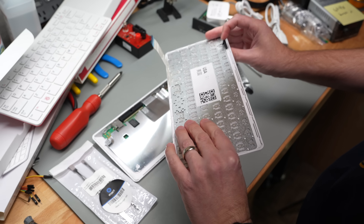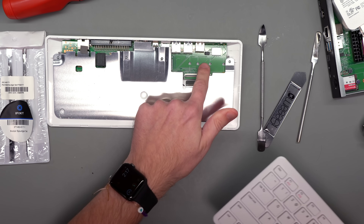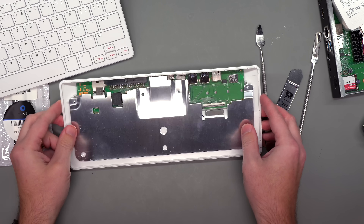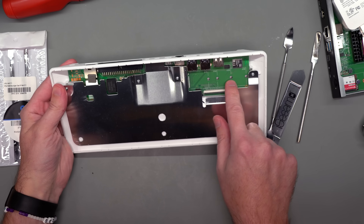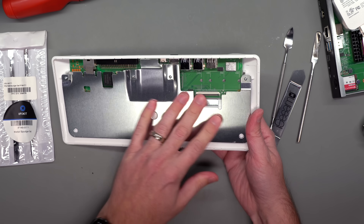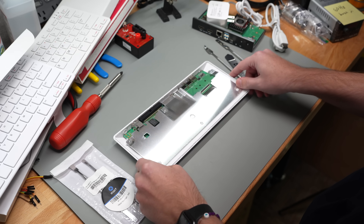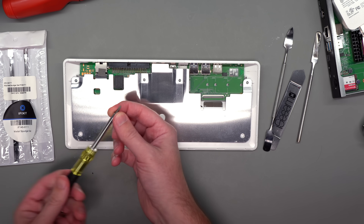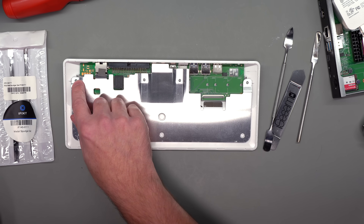There's a light pipe for the three LEDs that goes down to the little motherboard peeking out back here. The inside is dominated by the heat sink, just like the Pi 400. These screws are not really made to be user serviceable — if you use just a small number-zero screwdriver, it has a little play and it'll strip these screw heads. You might want to use a bigger Phillips head.